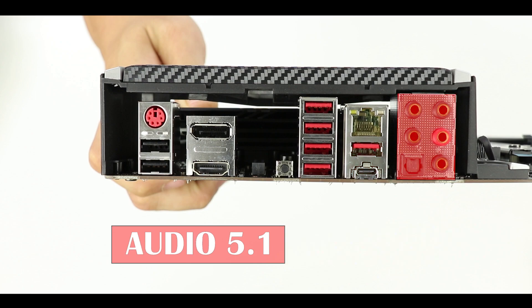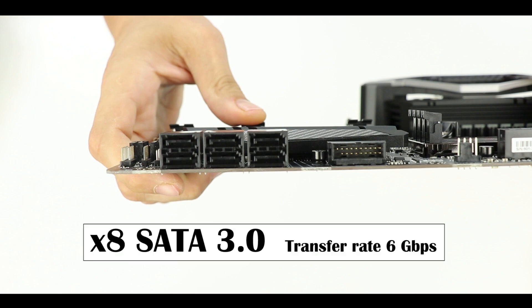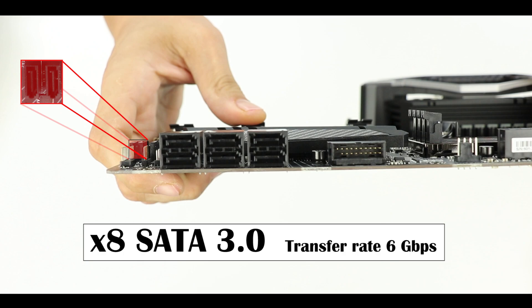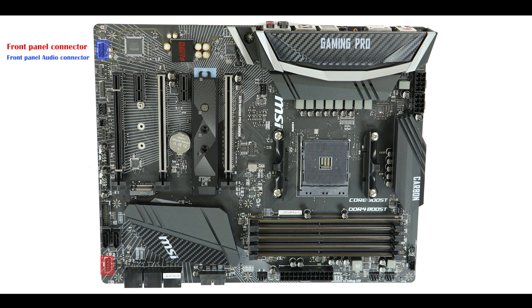The I/O also includes the usual five analog audio channels as well as an optical output. Turning the motherboard around, we have a total of eight SATA 3.0 plugs, all capable of transferring data at up to 6 Gbps. Interestingly, six of them are in the expected position while two are placed directly on the face of the motherboard. Connector-wise, we have front panel connectors, front panel audio connectors, two USB 2.0 internal connectors, and two USB 3.1 Gen 1 front panel connectors.